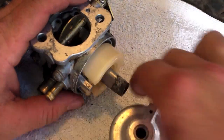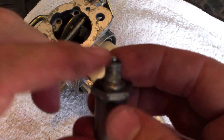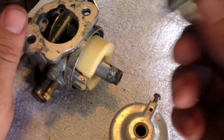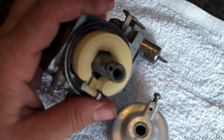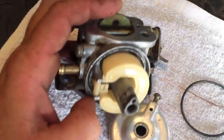This is the anti-backfire solenoid — it's been clipped. I'm going to keep this because it's now just a bolt holding it in place. You can take it out and toss it. This is the o-ring that I think will fit. I'm going to carry it with me when I go tomorrow, and I'm actually going to carry the whole carburetor with me just to make sure. More to come.